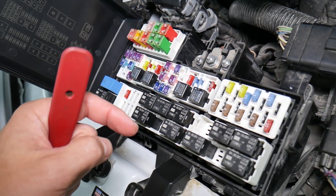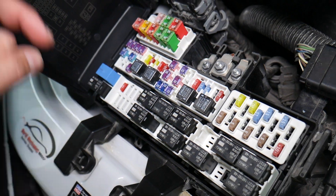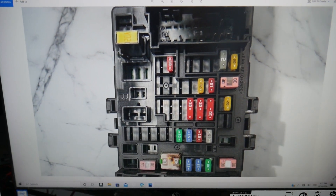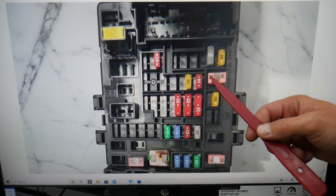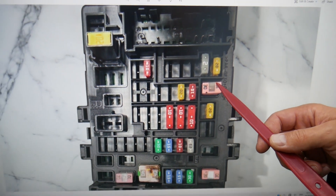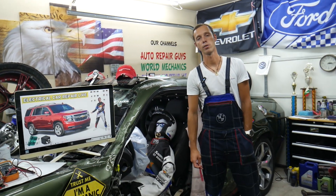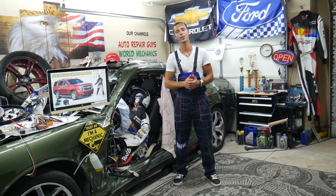We'll put a link to a special video that will teach you how to test fuses and check relays very easily. So here, what we need to check: fuse number 21, which is a 30-amp fuse. Those are special fuses that can be hard to find or overpriced, so we'll put a link in the description below. As for the relay — practically, you don't have a dedicated relay for the sunroof or moonroof; you have a fuse known as a relay fuse. If you have problems with it not working, always check that fuse first.